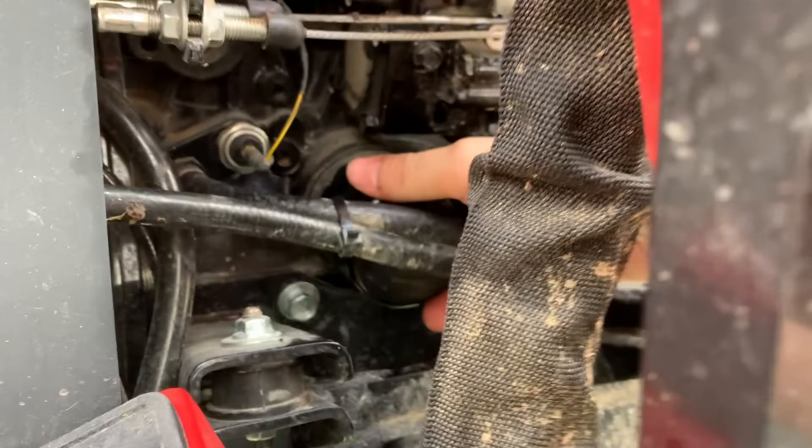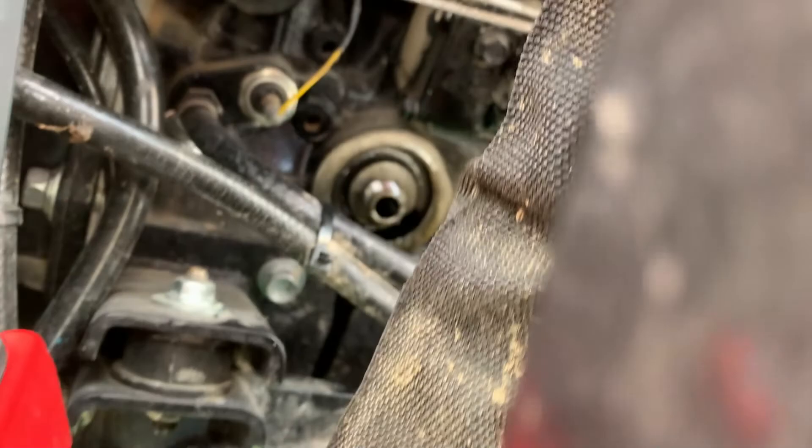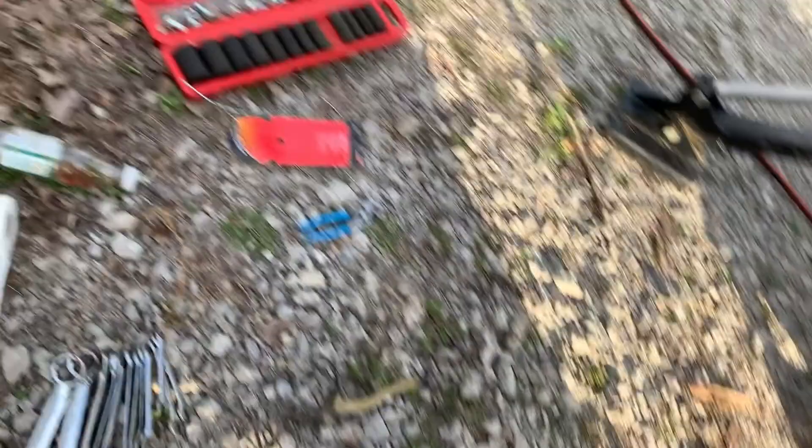Now that she's loose, don't forget to put the oil pan back under there because it's going to run out of that. And these hoses are kind of wedged down in this space — pull them out of the way so you don't just get them filthy dirty. And then back it off, tilt it down. It's going to run all out into the oil pan. Just let it drain for a minute.